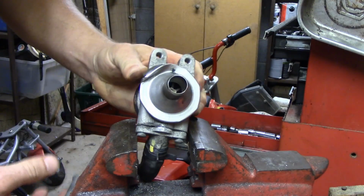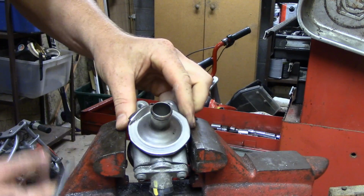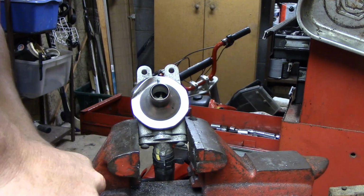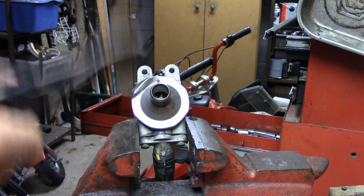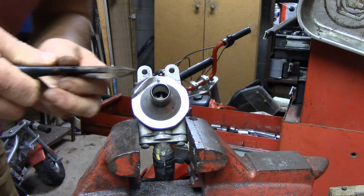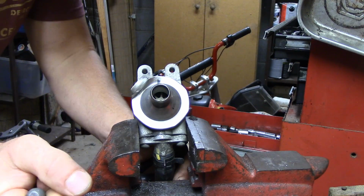Something else I wanted to mention here, maybe while I'm taking this apart. I had mentioned the oxygen sensors and seeing if they would change properly, and I didn't elaborate on that if they did not. So let's say we did all of our checks and we still have this air pump code. You can have an air pump that's not producing enough airflow, and that was where that comment came in about the oxygen sensors and how lean they would get and how much the fuel trims change and what the strategy is there. So that was that comment.